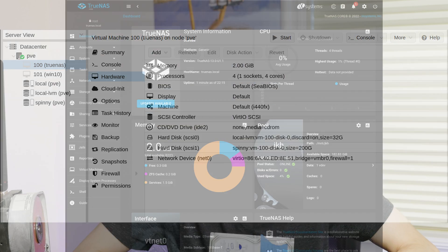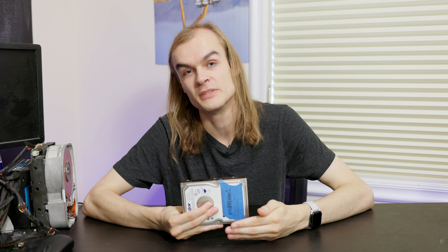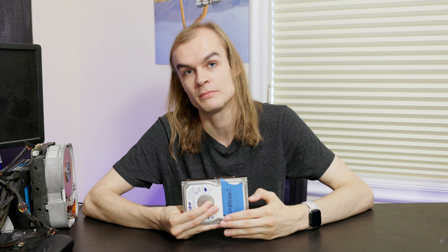The most optimal drive configuration for spindown is something like a true NAS VM with its boot drive stored on an SSD that won't spin down, and the data files on a spinning drive. When the NAS share wasn't being used it would spin down and stay spun down, and when I wanted to copy files it would wait a second for the drive to spin up and then work as expected. Leaving it mounted didn't seem to affect its ability to spin down, and it worked quite well overall.